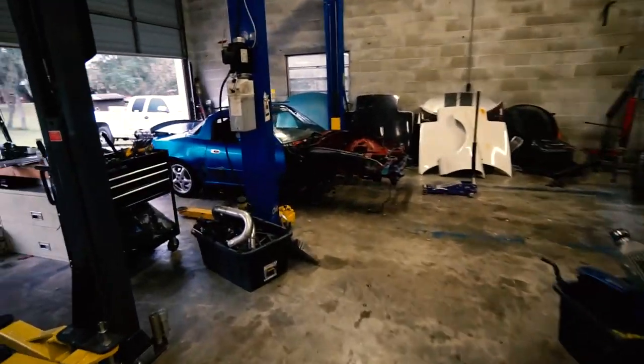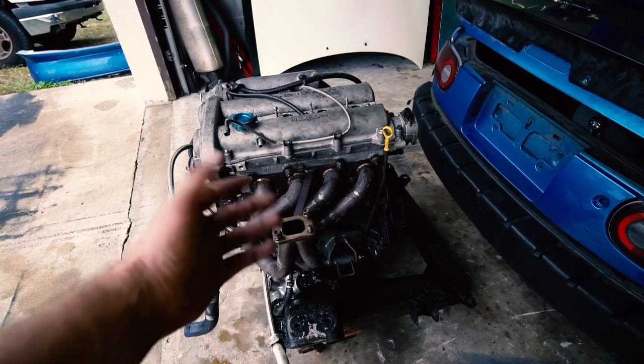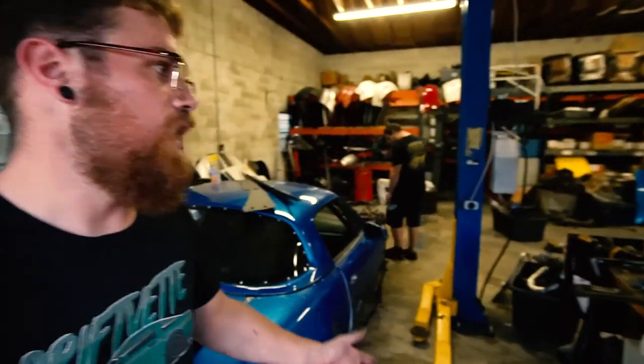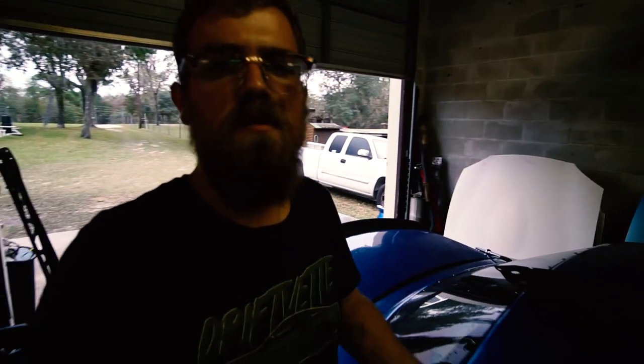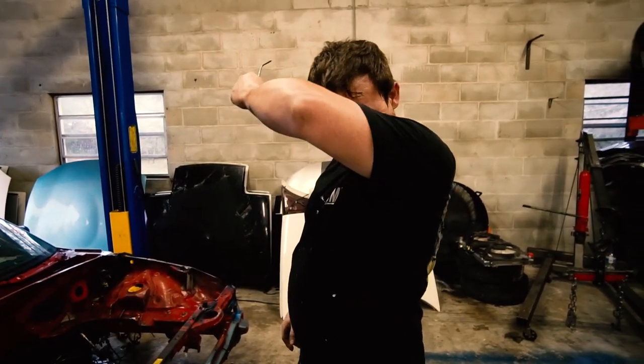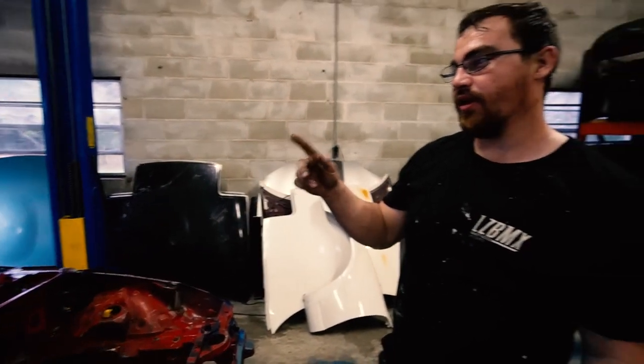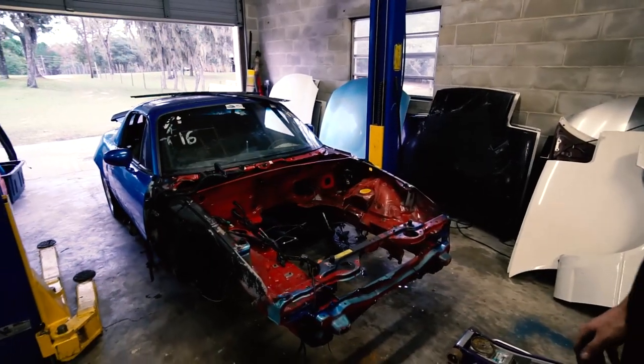Back inside — it was a pain because the rollers fell off into the grass, but the engine and trans are back in. Ben is going to come up with a plan. My suggestion is to replace this totally tubular manifold with a log manifold — you can buy the parts for pretty cheap, we could build it with a V-band flange, bottom mount, and it would be a lot easier to work with, cleaner overall. Obviously the tubular manifold probably makes more power, but log manifold is supposed to make more bottom end. We don't know yet. Ben's going to start ordering stuff so we can knock this out reasonably quickly. Worst case, we'll be making a manifold and a downpipe and changing intercooler piping. I'll see you guys in the next part.